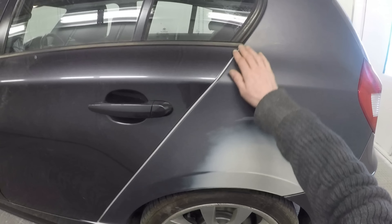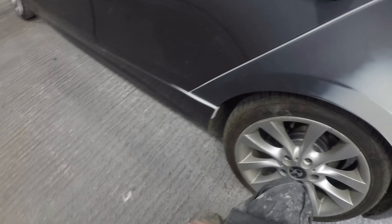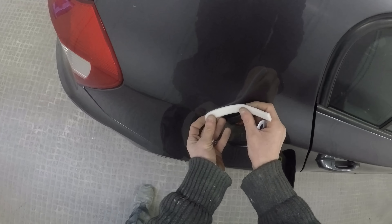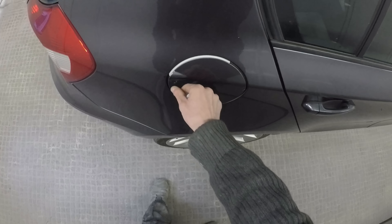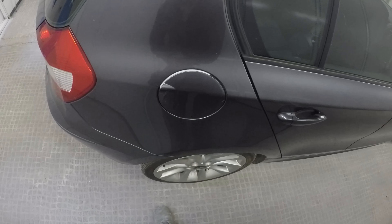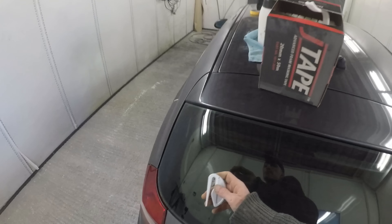The good thing, especially for those using water-base, is you could spray your base coat down and then push it in a tiny little bit further if needed, so when you hit the clear coat over the top it goes that little bit further and seals that water-based edge, giving you a little bit more flexibility. It's also brilliant for really finicky bits like fuel caps — because it's flat foam rather than a rounded profile, it fits in there, the fuel cap will still catch nicely, and it gives you that beautiful soft edge all the way around.